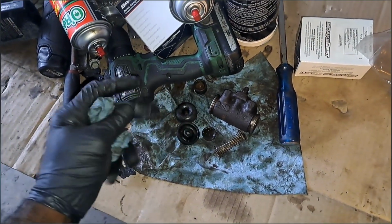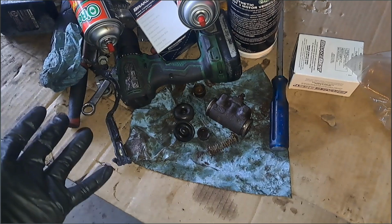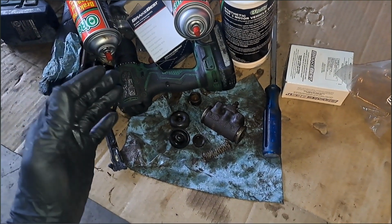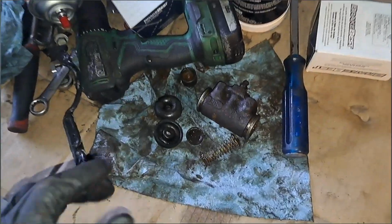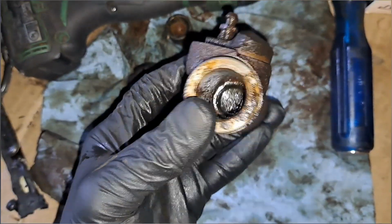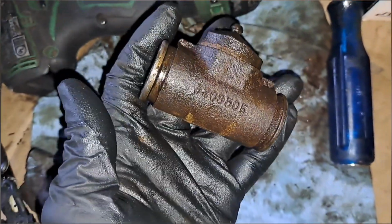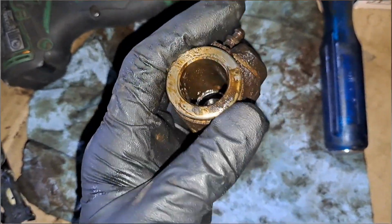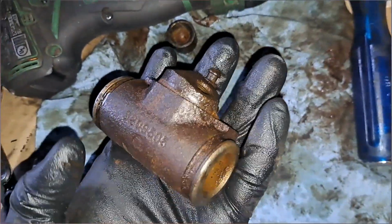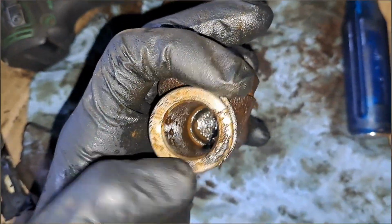So this is the second day of resolving the brakes. Now let me just state, we did have vacuum issues. When I would drive it, I'm not satisfied with the brakes. So it led me to check other things. And naturally I went to the back where the wheel cylinders were, and wouldn't you know, the wheel cylinders did have a small leak. This is just additional residue, additional brake fluid because of me having to pull it out. But it was pretty much dry, but it was leaking inside the boot.